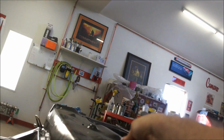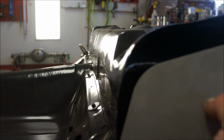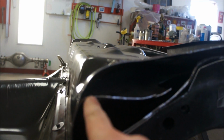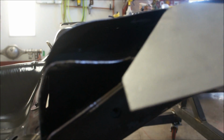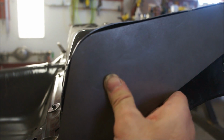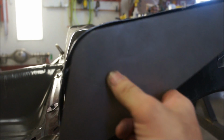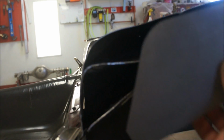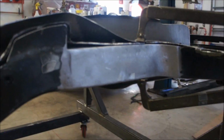So that's that side. Of course, I have to pop holes. I don't know if you guys know how this works, but basically you're going to put holes in this thing, but weld to this piece, this brace here, and then ultimately up here. But that's kind of where you'll hold that closeout panel on, according to what they show with the SE. And it'll also weld on down here as well. So, and then whatever's hanging off of it, I may go ahead and just carve that off and make this really a nice clean piece, kind of like what I've done there.